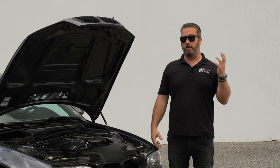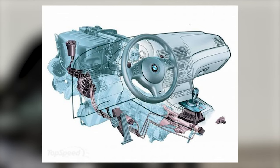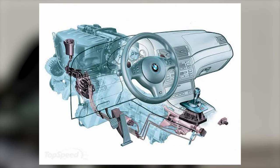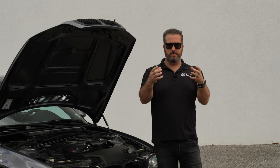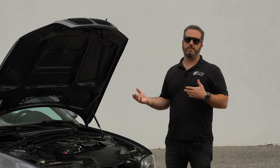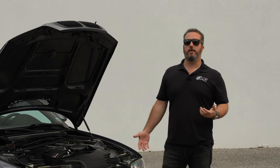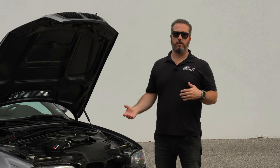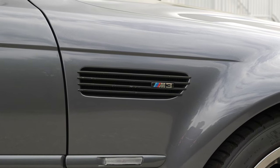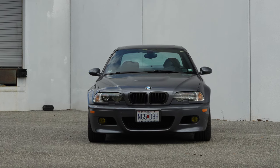An SMG actually has a clutch — it has a standard manual clutch and a manual gearbox, but it's actuated with a hydraulic system, so there is no physical clutch pedal. It's actuated and you shift with either the paddles behind the steering wheel or the SMG knob. That was new tech for 2001 — an epic thing. A lot of people were ordering the cars and wanted SMG because that was the new thing; SMG was faster than manual cars. Over time, as SMG ages, it gets clunky, it gets inaccurate, and it leaves people stranded. That's why we're doing so many manual swaps on E46 M3s.